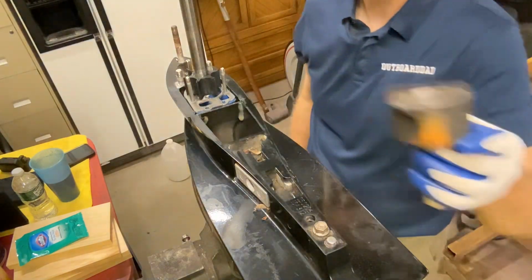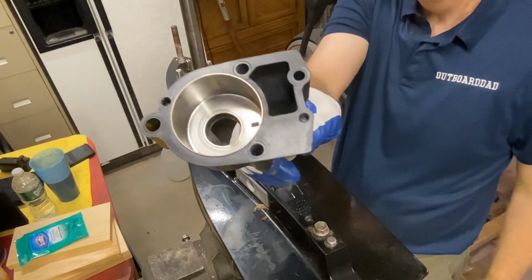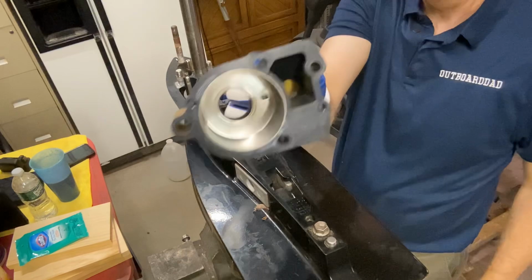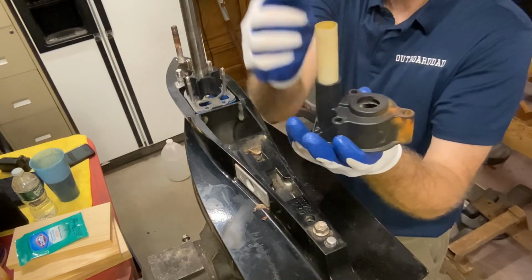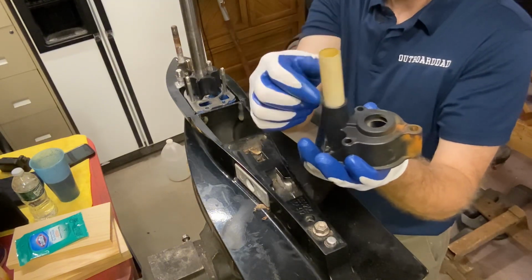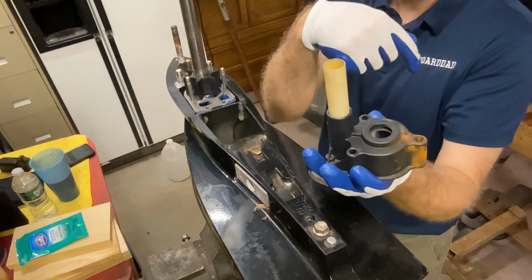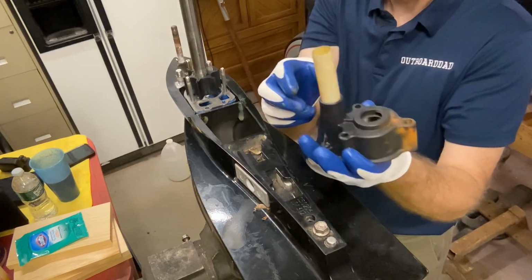I'm also going to take and put some sealer around the outside. This is very clean. I just really cleaned it up, nothing else. So it's in really great condition. I just stuck this back in here. This was up on our tube, which we're also going to do a test out at the motor. I'm going to hook my hose up and make sure we have water flow through after we put our poppet valve and our thermostats in.